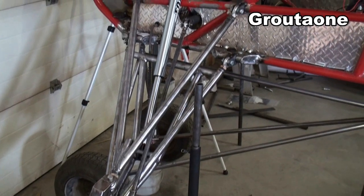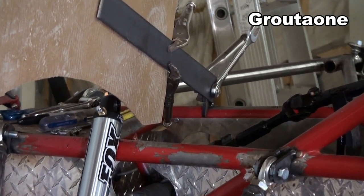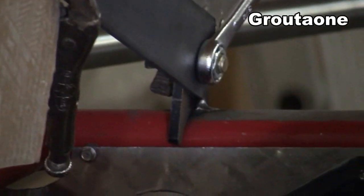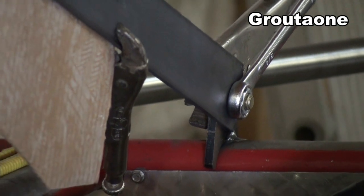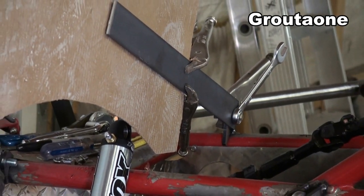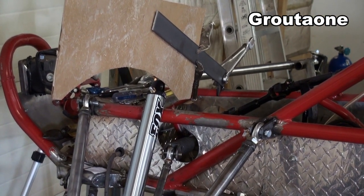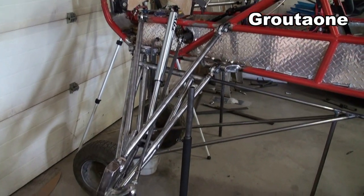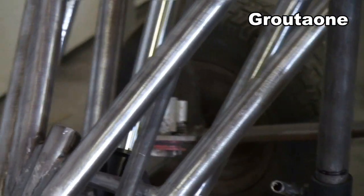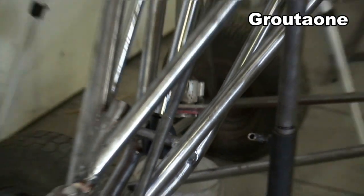I'm getting ready to make a mark on this piece of cardboard up here, and I've got my fantastic family of vice grips helping me out. There's a temporary bracket I just spot-welded to the frame, with a piece of flat plate bolted to it, and onto that is clamped my piece of cardboard where I'm going to make my mark. Right now the suspension is extended to the max — actually a little bit beyond — to take into account my limit strap. The shock has its brackets spot-welded onto the lower arm and is sitting in its proper position.